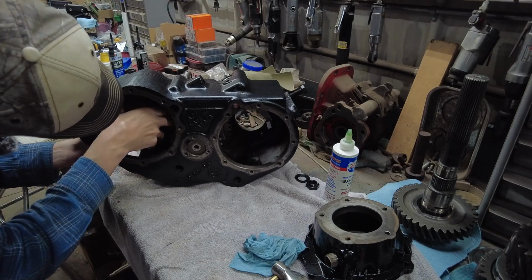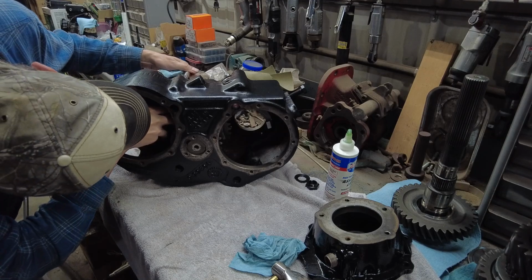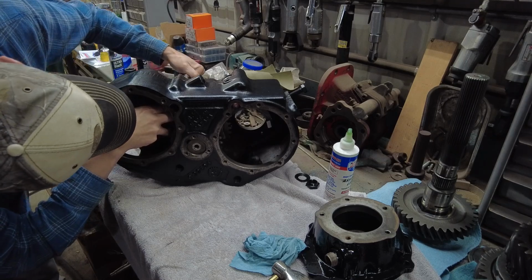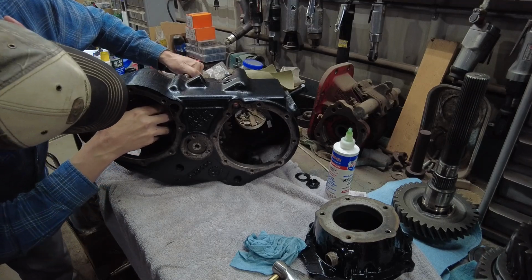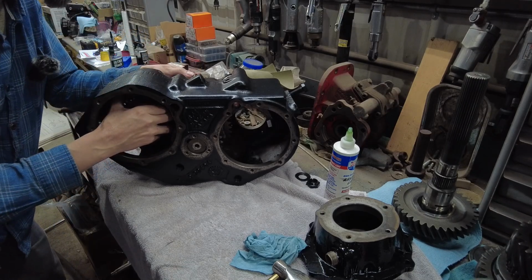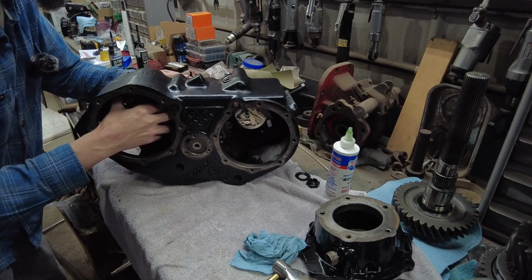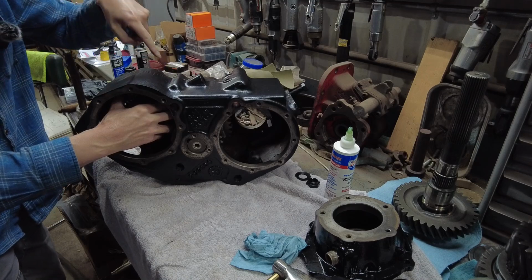So if I can find, I'm putting it on the gear there. I'm getting my shifter. And I got to put this shaft through my shift fork, which is easier said than done. There we go. Now remember your detents. I know you can't see them, but remember the detents? They go upwards. And to see here, I don't know if they want this one in neutral too, but we're going to line up the middle detent with this hole right here.